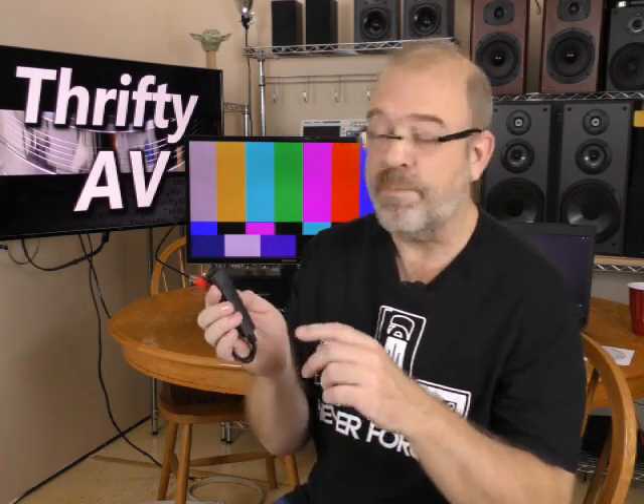You may have noticed this video is framed differently and has different resolution than most videos I upload, and that's because I wanted to match the native resolution of this EasyCap device. I can do PAL or NTSC, but I'm doing NTSC converted to 480p. NTSC is normally 480i, DVDs are normally 480i, so there will be some conversion, but 480i to 480p shouldn't be too big a deal, and I have to go progressive scan anyway because YouTube is strictly progressive scan.